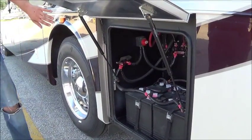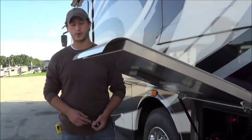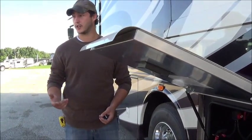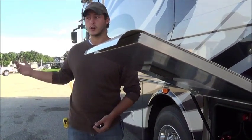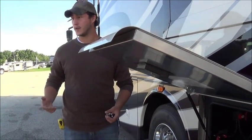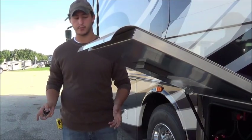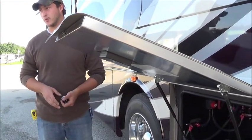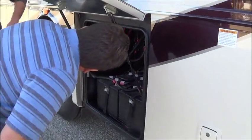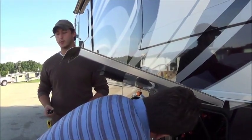In there, that's going to be the larger main circuit breakers. Those should never trip unless — going back to like that surge guard — if you were plugged in and had something, like lightning struck or you had a brownout or over voltage. If you didn't have one of those surge guards put in, I've seen this happen — it could go into your 12-volt system and start blowing a lot of stuff. But in normal usage, this should never blow. Those are just protections built in if something weird happened.